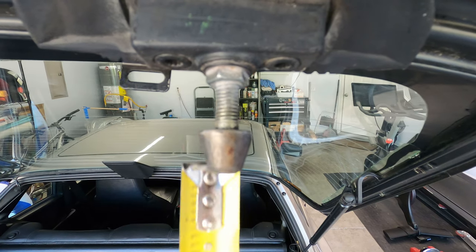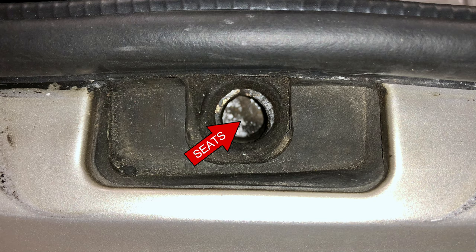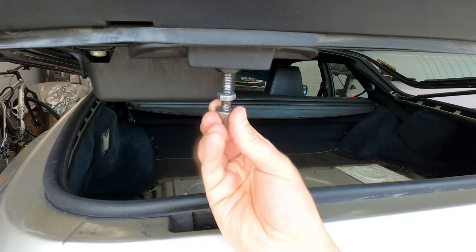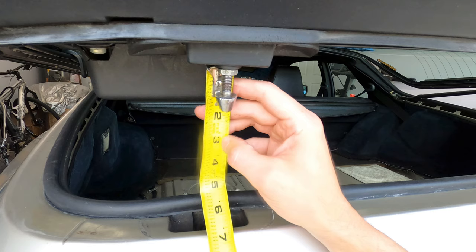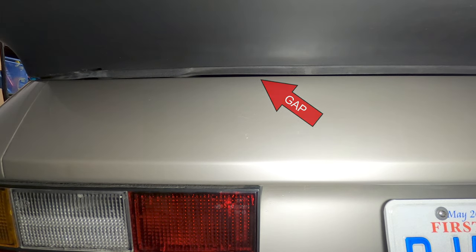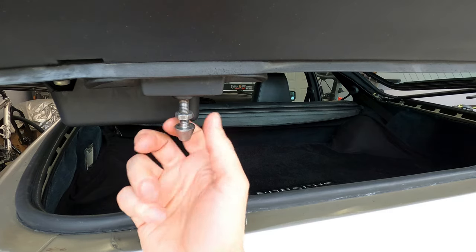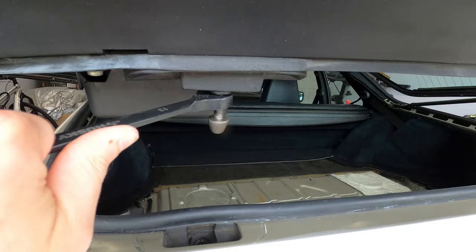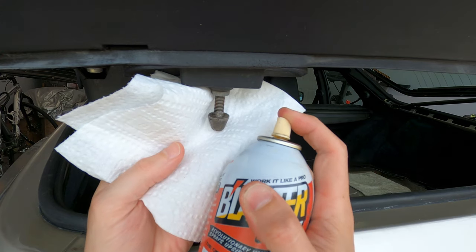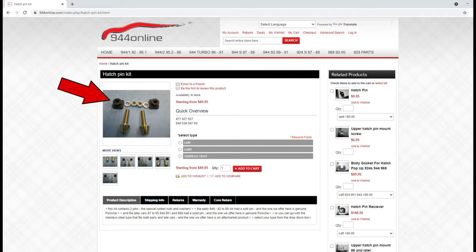It's also a good idea to inspect the height adjustment on each of the hatch pins. If your rear hatch is rattling or loose when it's closed, it could indicate that either the hatch pin seats are worn and due for replacement, or that the hatch pins may require adjustment. When adjusting or replacing the hatch pins, the left and right pins should both extend from the hatch in generally equal lengths. You can then close the hatch and check for any gaps on the left or right side between the rear body panel and the urethane spoiler, tightening any of the pins to eliminate the gaps. As you begin to work on the pins, you may find that they've become rusted in place, in which case you should first apply a wire brush and some penetrating lubricant to avoid breaking the pins. If the pins end up breaking, you'll need to drill them out and tap the threads, or simply replace the retaining mounts on the hatch along with the pins themselves.